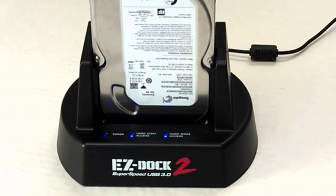When the hard disk access 1 light starts blinking, switch the number 3 tab on your jumper to off. This will begin the actual cloning process and the HDD1 access LED will blink. When the HDD1 LED stops blinking, that means the cloning process is 50% complete and the hard disk 2 access LED will begin to blink. Once the HDD2 LED stops blinking, the cloning process is 100% complete.